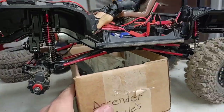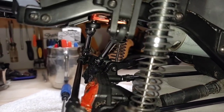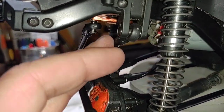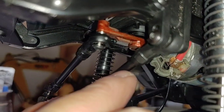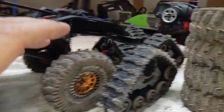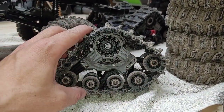Viewers Will Anderson and Chad Nelson threw out the idea of going back to that factory servo mount. Good idea. After going back to that setup and doing some minor readjusting, we got all this stuff jiving correctly. Talking about our servo horn rubbing on the panhard bar previously - this is a factory Traxxas metal servo horn and I painted it orange with a neon Sharpie. Right around the hub where it attaches to the servo, that's where it was rubbing on the back of the panhard bar. My last run with the deep lug paddle tracks versus my brother's truck with the 2.2 Super Swampers - we hogged out the adventure course.